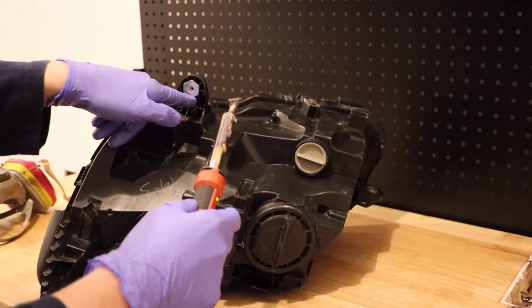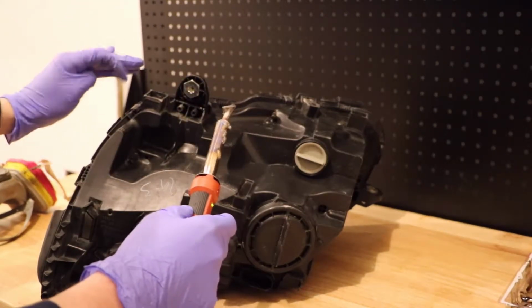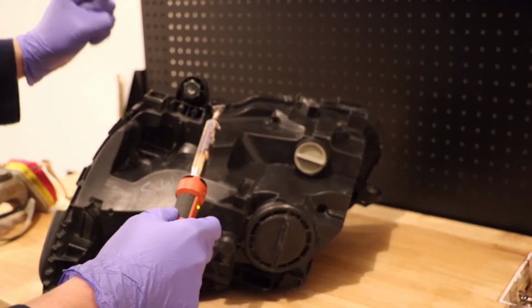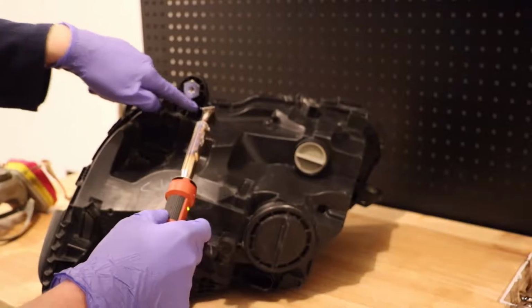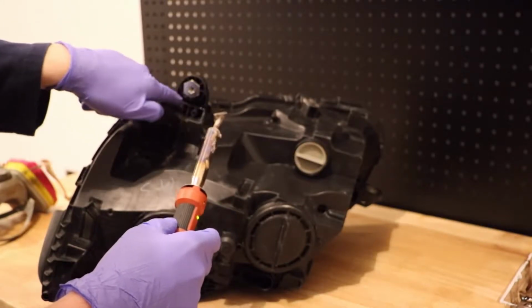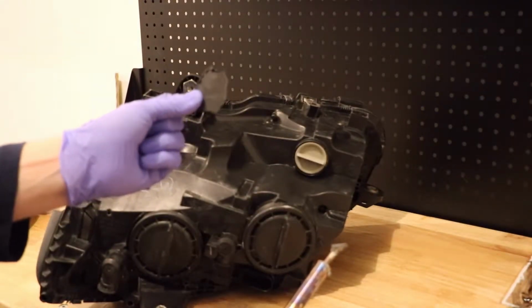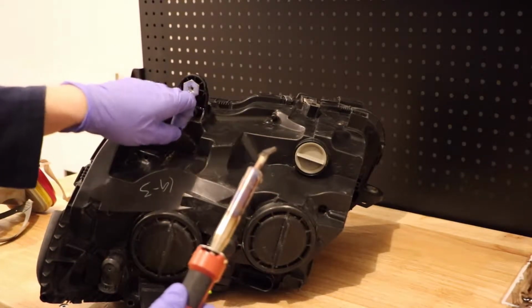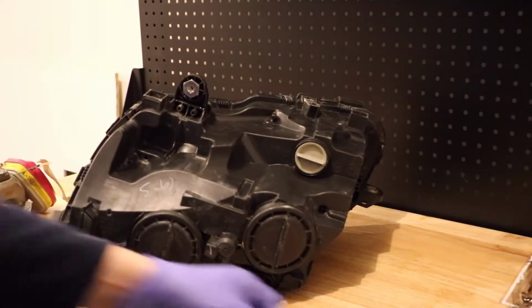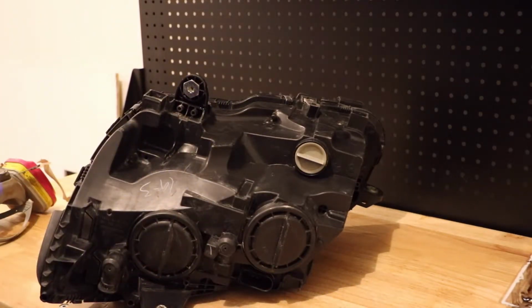into place. So we'll start by just melting along the seam to force the plastic to try to weld back together, and then we'll go along the inside here. I'm going to melt the inside first, and then I have some plastic off of another broken light that I'm going to melt and stick in here and build up a bead along that inside edge to reinforce it.